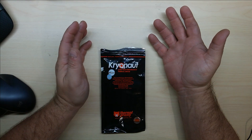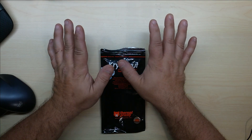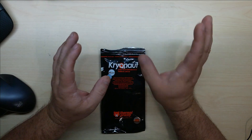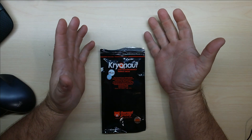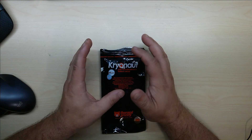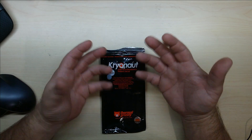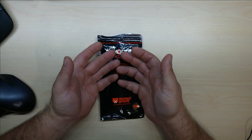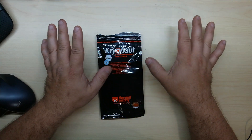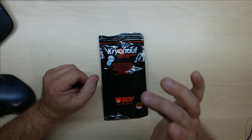It's the next day — my co-worker said his son played for an hour and a half last night, no problems whatsoever, no overheating, no shutting off after five or ten minutes. Sorry this video wasn't like an iFixit teardown. The moral of the story: don't keep your running electronics on the ground or they'll get clogged with dust. Also, the PS4 has a really crappy factory paste job for the CPU and heatsink — if you're going to tear it apart to clean the dust, you might as well repaste it and never have to open it again.